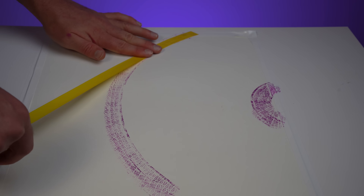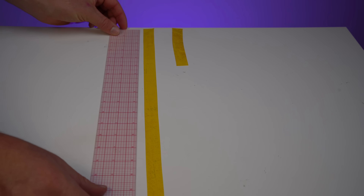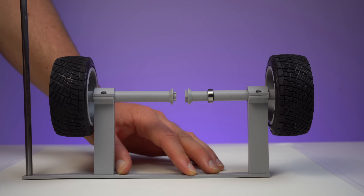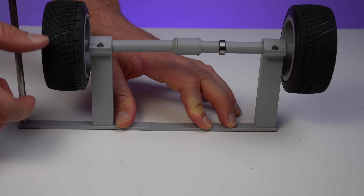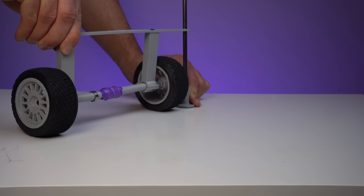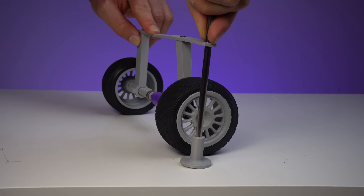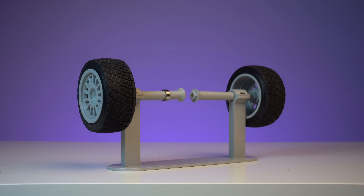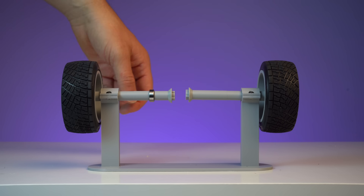You can certainly see which path is longer when I transcribe them into straight lines. The wheels are free to rotate at different rates because they're completely independent and not connected to one another. If you add a part that connects both wheels so they must rotate together, either one or both wheels have to skid, slip, or lose traction. So obviously that doesn't work for a car — both wheels need to be able to rotate independently and at different speeds. So how do we get power from one motor to both wheels while allowing them to rotate at different speeds?